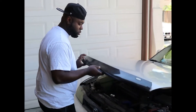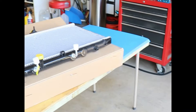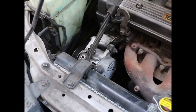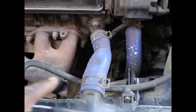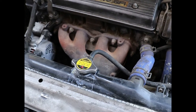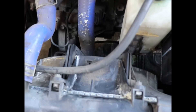Now we're going to open up the hood — and here's the radiator. Out with the old, in with the new. First up we're going to drain all of the coolant out of the radiator. Then we're going to take away the brackets, take loose the top and bottom hoses and the overflow tube, then remove this radiator and install the new. Don't forget to transfer the cooling fan when you swap the radiator.